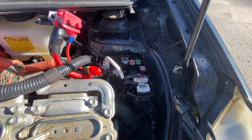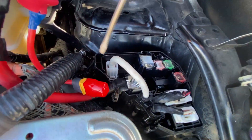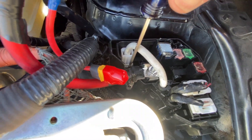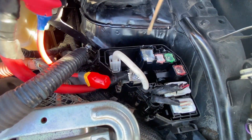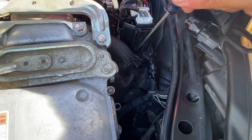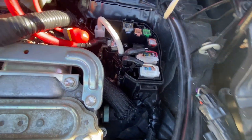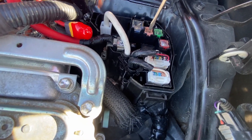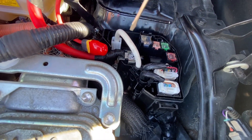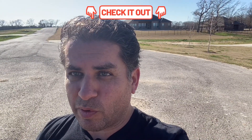We are all done with the repair and everything is nice and snug. If you have a hybrid vehicle, this fuse will be associated with your DC to DC power. If you have a non-hybrid Toyota, this will be associated a lot of times with your alternator, or if you jump the vehicle backwards. A couple of tips: take your time, find those clips and put the screwdriver in, go all the way around. Drop it down, remove all the fuses, and with the right clips pushed in it will allow you to back this up. If I helped you save $100 or $1,000 and you want to show some love, I have a link down below to support the channel. Thank you so much.